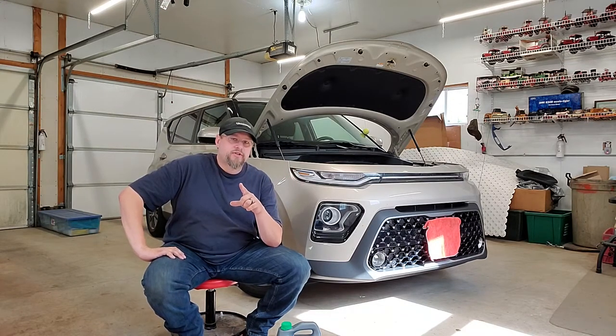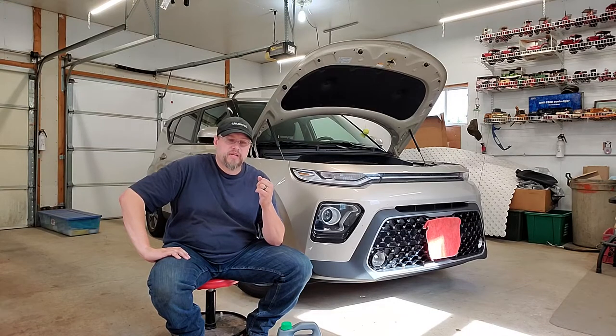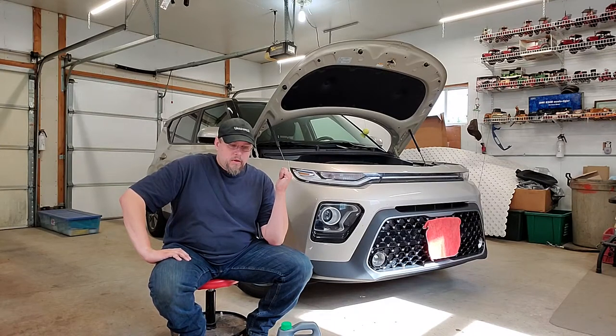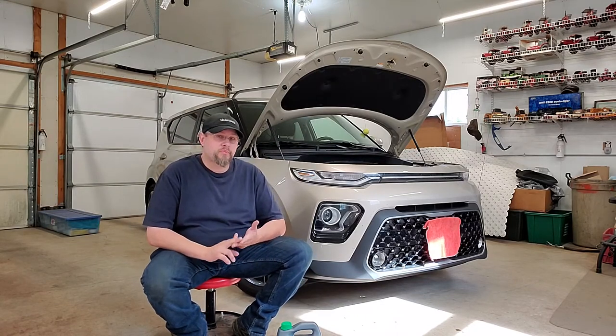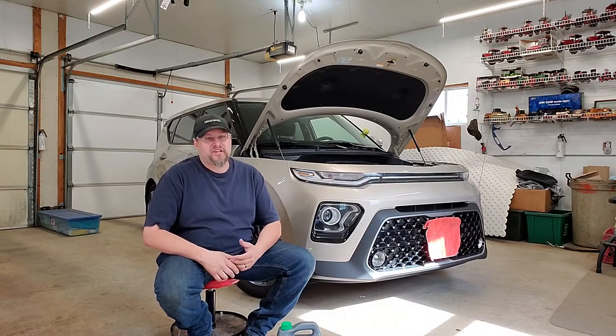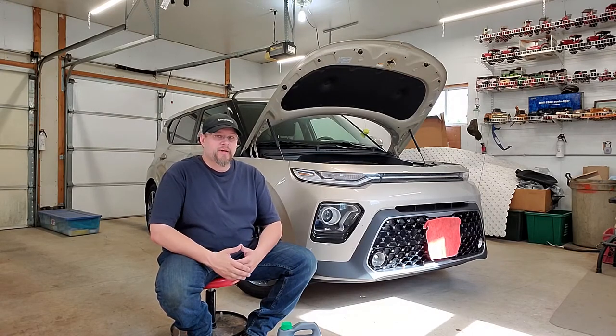I want to make sure it's a good system — nothing cheap. You can buy cheap ones on Amazon and I've had one on the two-wheel drive tank, but I'm still nervous about putting a cheap one back on until I fix the hard start issue. I want a good cold air intake because there's a massive restriction in the system somewhere. It will help fuel mileage, performance, and longevity of the car because it won't be starving for air. Check your air filters — I'd say every two to three oil changes, go ahead and toss a new filter in.